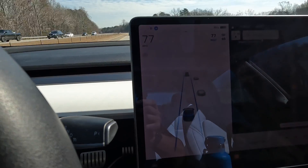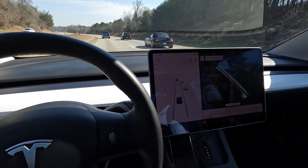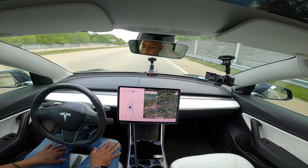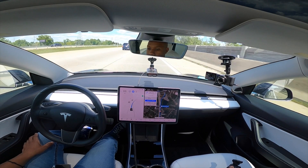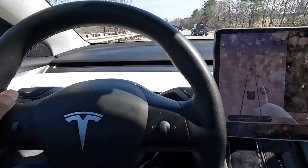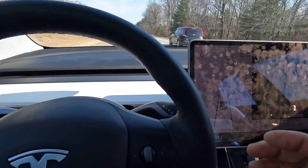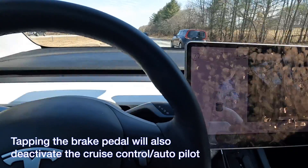If you have autopilot or want to use lane keep assist, go ahead and click the cruise control stalk down one more time. You can then release the wheel momentarily — keep light pressure on it, not really gripping it — and the lane keep assist is active. The blue line on the screen shows you that you're in lane keep assist and you can adjust your speed from there. If you have the adaptive or full self-driving package, turning on your right turn signal will initiate a lane change — the car will check that it's clear, make the lane change, and then deactivate the turn signal automatically. To deactivate the system and cruise control, just push the stalk up and you're back on manual driving.